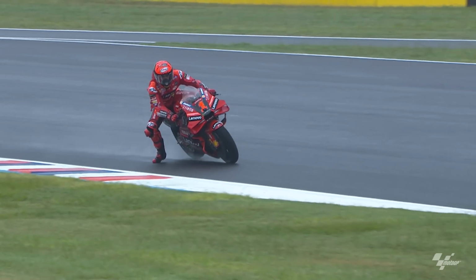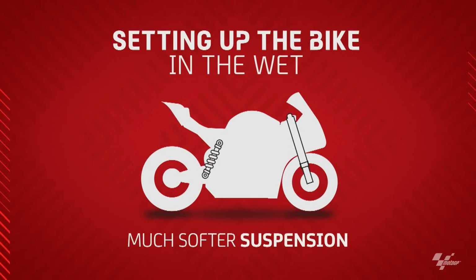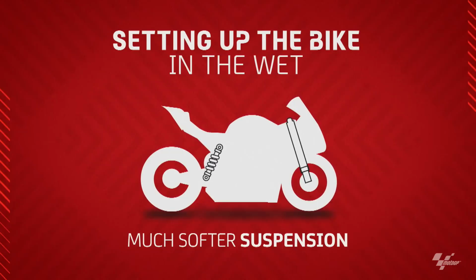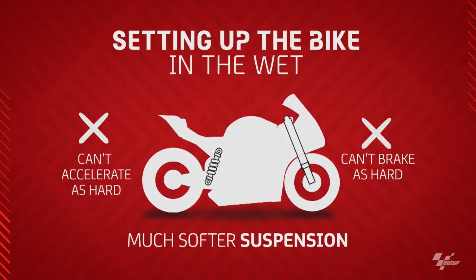From a dry bike to a wet bike, the most critical thing that we change is we make the suspension much softer. You don't put in as much effort, you can't brake as hard and you can't accelerate as hard. So they try and just make everything softer so the bike works more normally at a lot less speed.